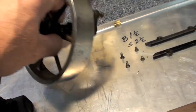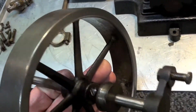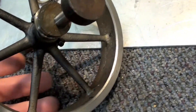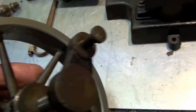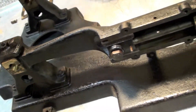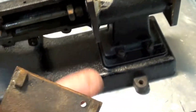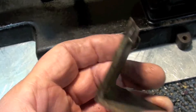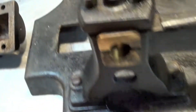The flywheel was fairly rusty on the rim, so I stuck it in the lathe, chucked it up on the crank, and polished up the wheel — got it looking pretty decent. The connecting rod was just heavily pitted with rust, so I put it in the lathe and cleaned it up. This is the brass lagging that goes on the cylinder — just a heavy chunk of cast brass that will clean up nice. I think the combination of clean polished surfaces and the old patina will look really neat on this engine. I really do not want to paint this engine — I want to leave it with its original look.